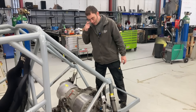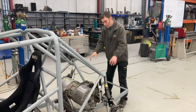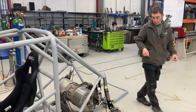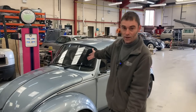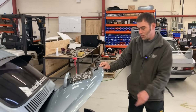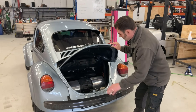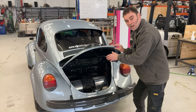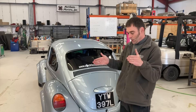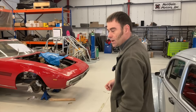The rear motor's in now. You'll see this is slightly different to how I was discussing it in the previous video, because previously I was going to hang a motor at the back like in a typical Model S configuration — essentially hanging behind the drive shafts. But I decided it would be a better idea to put the weight in front of the axles, because with any race car, having the weight between the axles is better for cornering and handling.